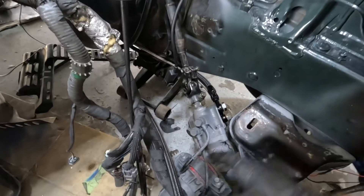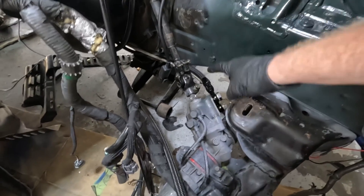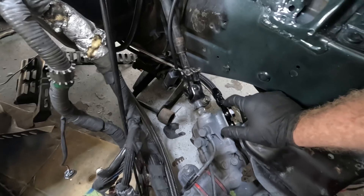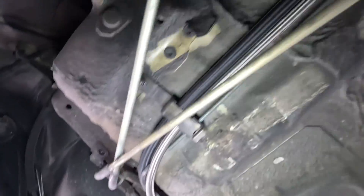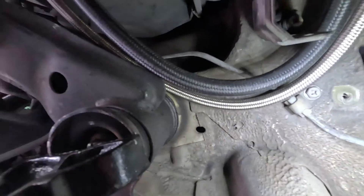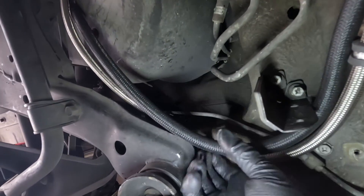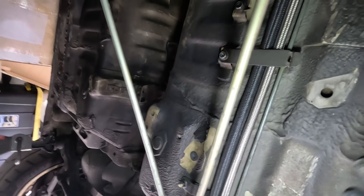For the front, I tied into the factory power steering rack using the two banjo bolts I showed earlier. This is my low-pressure return line, and then my high-pressure Russell Performance AN line — both 6AN running to the back. I reused a lot of the brackets; some have rubber boots in them and others had plastic. I ran it all the way along here, up the back, wrapping around and curving up under the fuel tank and over the subframe to the rear. I'll throw some zip ties to keep it tucked up out of the way.